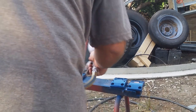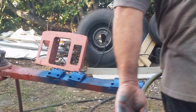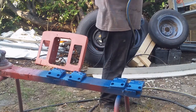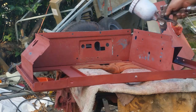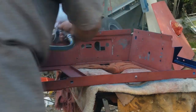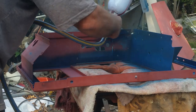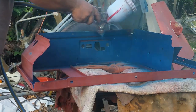All your bits and pieces get done separately and then bolted together in a couple of days once the paint is hard. So I've got paint on everything, under everything, between everything — and we shouldn't get any more of this dreaded Land Rover rust problem. The front panels of a vehicle are very prone to stone chips, so this paint I've chosen is very very chip resistant. I've even gone to the trouble of using a coarser grade sandpaper on the grill just to key the paint a little deeper into the primer, and I'm going to be laying on extra paint to compensate for the rougher sandpaper — so it'll still look shiny but will be absolutely keyed in to the primer on the front panels and front guards, and should stop a lot of the stone chips down the line.